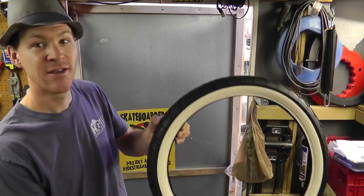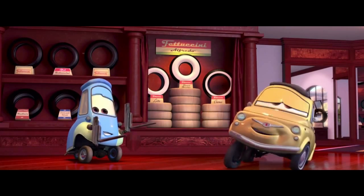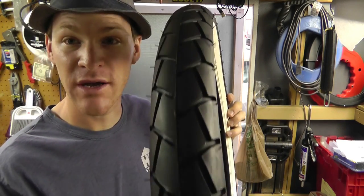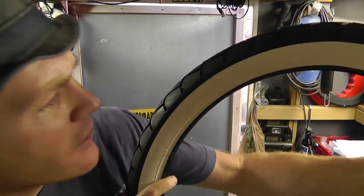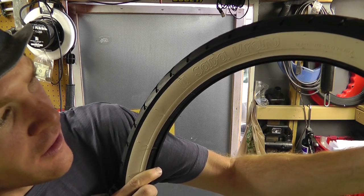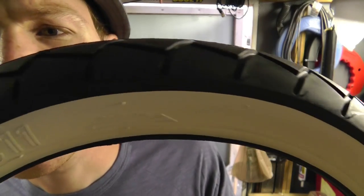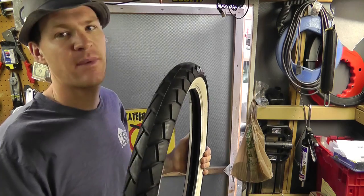Not only tires - white wall tires! White wall tires. Check out that tread - nice for what I'm going to be doing, which is lots of cornering. Doesn't really rain out here. These are 2.25 by 17. I can't pronounce the name on these things - S-A-U-A-K-R-A-N, maybe K-R-A-U - I don't know. The letters are kind of funky. They're directional, these are MC 11s. Look them up and you'll find them. I feel very unsafe riding on my old tires - they're not rated for what I'm doing.